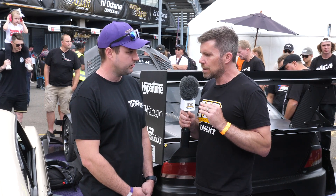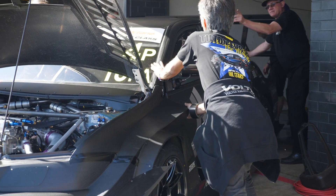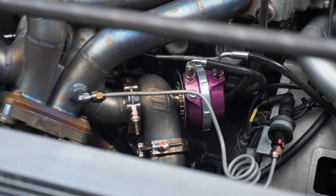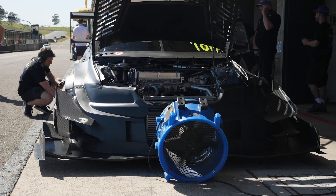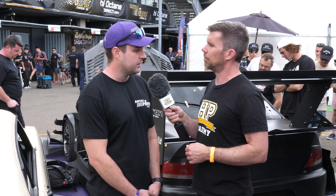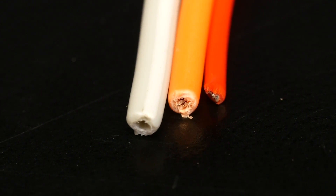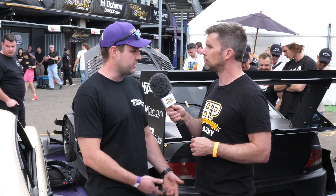For viewers thinking about what makes a professional motorsport wiring harness — you often hear the term mil-spec thrown around. What would you define as the difference between a garden variety wiring harness and something like you've built here for the Tilton Evo? Most of it really is just the wire. Motorsport wiring uses Tefzel wire. There's a huge difference between Tefzel wire and general wire — mainly the heat rating, secondly the stranding, and thirdly the fact that it's tin-coated copper, whereas standard wire is plain copper and you run into corrosion problems.